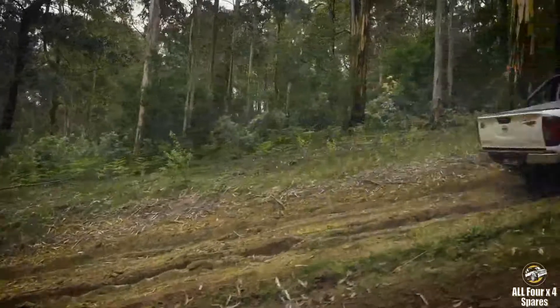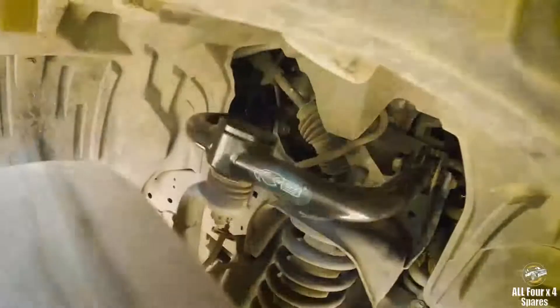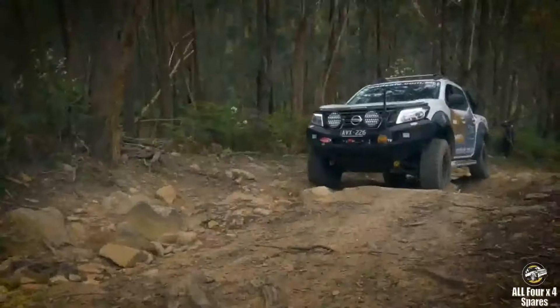What we do is rotate the cup slightly, so the ball joint is more central on a lifted vehicle. It travels through all those arcs a lot neater and without binding, which is an important part.